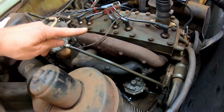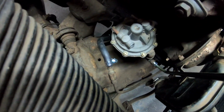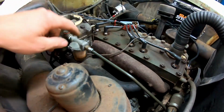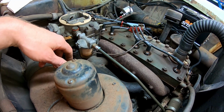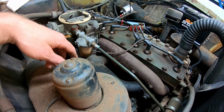Here we go. We've got our feed line down to the pump. Everything is clamped and tight. So what I need to do next is pour some fuel in this thing, and we're gonna prime the system by letting it flow free out of here. So we're gonna cycle some gas through it since there might be dirt and rust in the original line. So I'm gonna pour about 5 gallons in the car, flow about 1 gallon through it, and see how it works out. All right, the moment of truth.